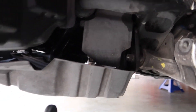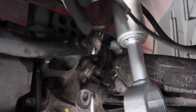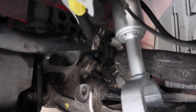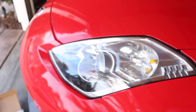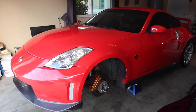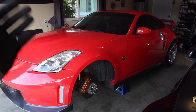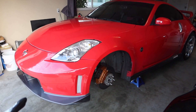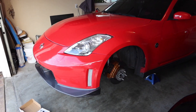So right now what I'm going to do — I already got the wheel off — I'm going to drop down some of these lower panels and drop the entire sway bar itself. That way I can drill this thing out properly, install the end link on there, and then install it. After all of this, you want to make sure you definitely get an alignment. I can honestly notice a very big difference having the sway bar and end link connected versus not having an end link at all. If you have a car with a sway bar, make sure you are running that end link.